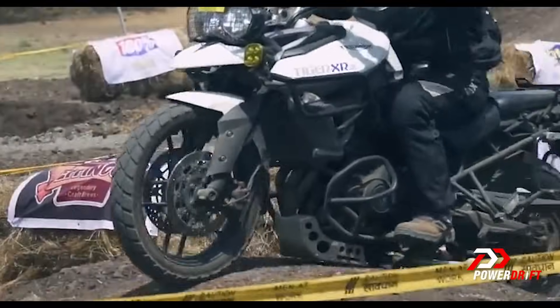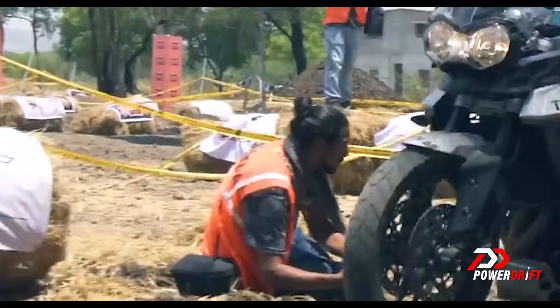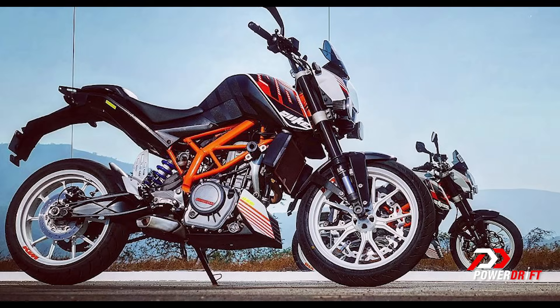Setting up suspension well dramatically changes your feeling for a motorcycle. My favourite example is my KTM Duke 390 — it had stock suspension for the longest time, and I found a massive improvement just by changing the rear shock to an old used Yamaha shock that wasn't even serviced at that point. Today I've changed the spring rate to match my weight, set up the front with a preload-adjustable unit, and set sag at both ends. It's now one of the smoothest, most pliant and frighteningly capable KTMs I've ever ridden. If you have a motorcycle with adjustable suspension, do spend the time to adjust and set it up — it'll dramatically change how you feel about your motorcycle.